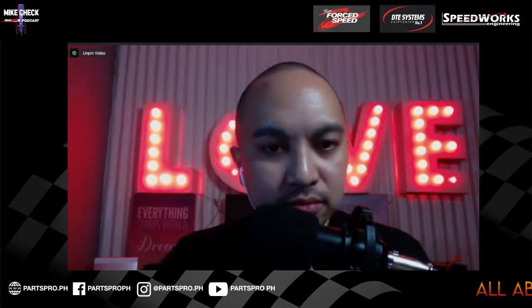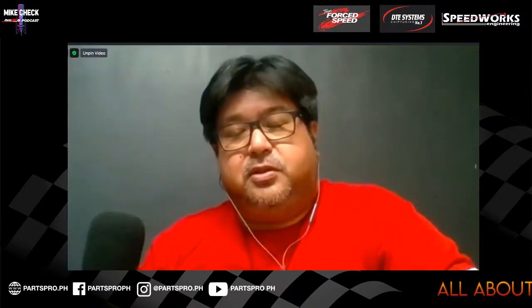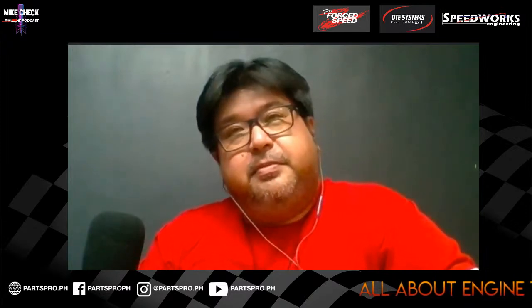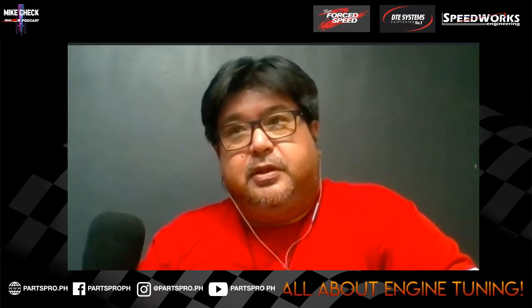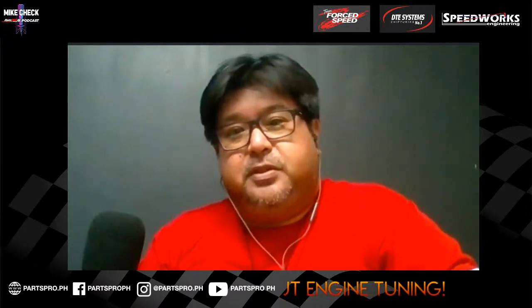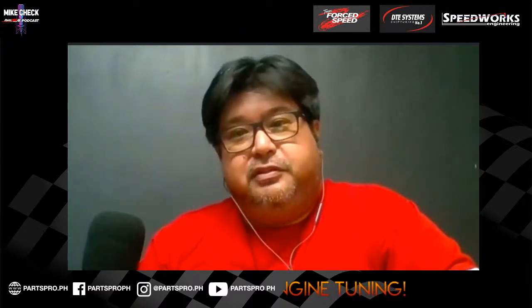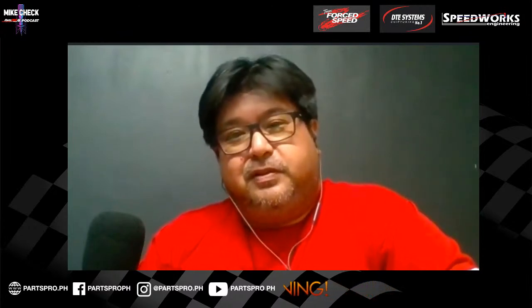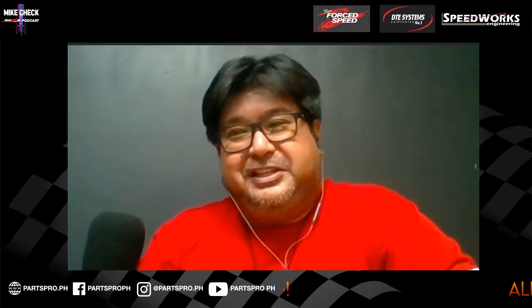Jeff, I'd like to ask you. Yeah, for me, because mostly I tune all-motor cars, my air fuel at full throttle is around 12.8, 12.9. But it depends upon the purpose. If you're going to use it purely as a drag car, I go on the edge a little bit.